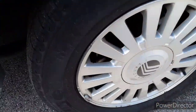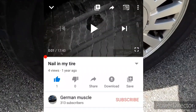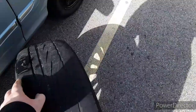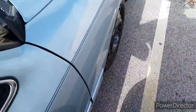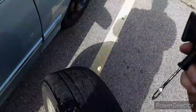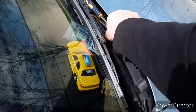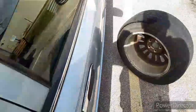I actually made a video a really long time ago where I plugged this tire — that was about 10 months ago — and these plugs do really well. Don't take your stuff to a shop to have them plug it because that's really expensive. You can get this whole kit for like five bucks at Walmart or the dollar store. It comes with like three or four plugs, the tool I just showed you, and a little grinder-looking thing. Also, take the nail — don't throw it on the ground because you can pop your other tire with it.